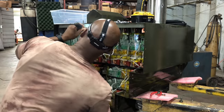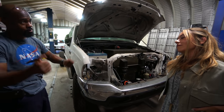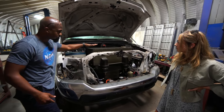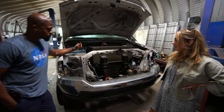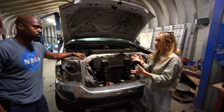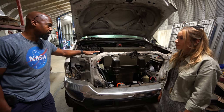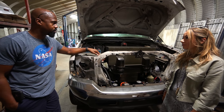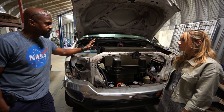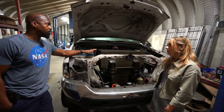All of this weighs right around the exact amount of the motor. So what that means is with the suspension and the handling, when you take this out the truck raises up and becomes tail-end heavy with that little swirly feeling. When you drop this in, it sits in just like a motor would — we have motor mounts so this can bolt in with seven bolts. The Tesla was designed to have batteries at the bottom for a low center of gravity, which makes it one of the best handling and accelerating cars out there. This truck, however, was designed for torque, pulling, climbing, and off-road, so we had to make sure there was about 60% of the weight on the front and 40% on the rear, just like a regular vehicle, and also compensate for when you're pulling or towing.